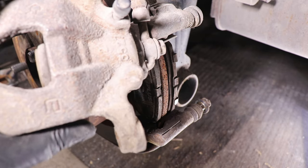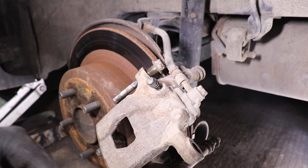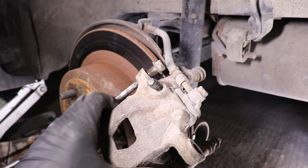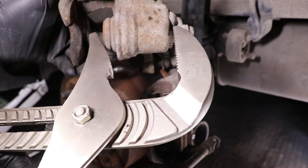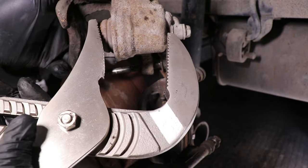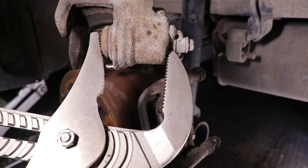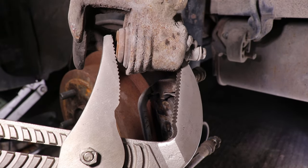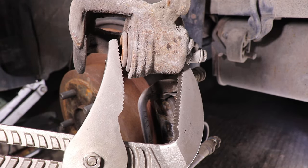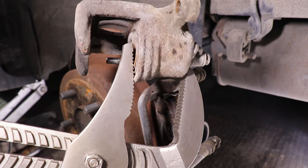So now the only thing left is to blame the caliper — the seal inside is probably sticking a bit. A seized caliper is pretty easy to diagnose if the piston is completely seized, because when you go to compress it it's not gonna move at all. But for ones that are just starting to seize, the piston is just gonna retract just fine — like so, with minimal effort.